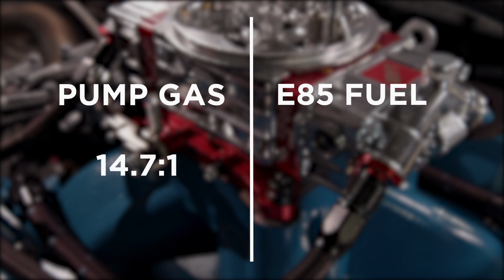It does come with some negatives though, namely E85 takes up to 34% more fuel because it has a lower stoichiometric ratio than pump gas, which is usually 14.7-to-1, while E85 is around 9.7-to-1. This means a lot more fuel has to enter the engine with the incoming air. To accommodate all of that additional fuel flow we'll need, we'll have to make some changes up top.